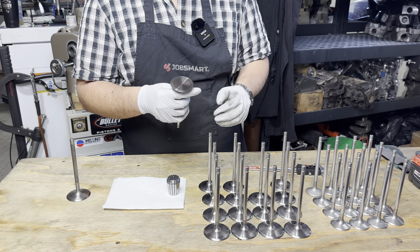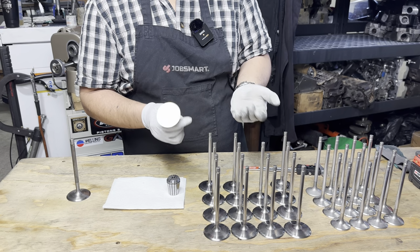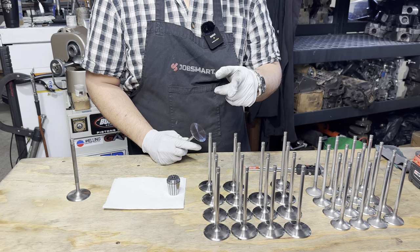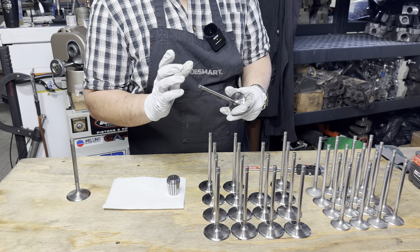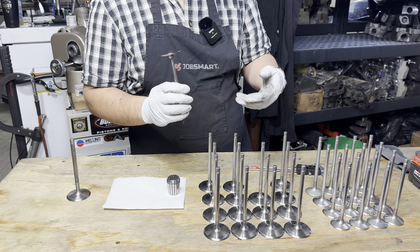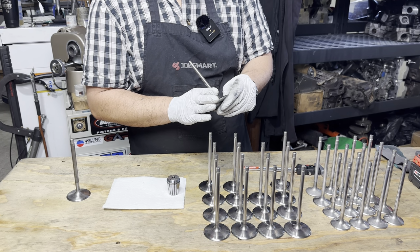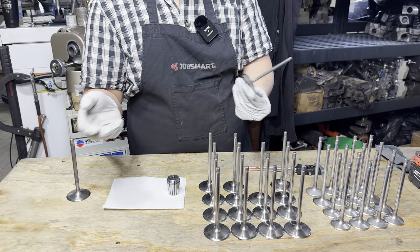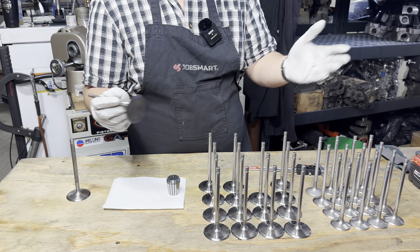I got lucky. The heads of the valves are coated with a CRN coating. That's a type of PVD coating. You engine nerds in the comments, quiet. If I got that wrong, just keep to yourself. The CRN coating is really tough. If you leave these in the tumbler for too long, I suppose you can hurt it. You'll see the edges start to soften up on the titanium valves, and you can erode the coating if you leave them in the tumbler for too long, but generally about 3 or 4 hours is plenty of time.